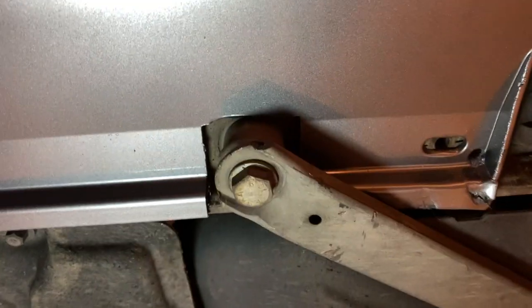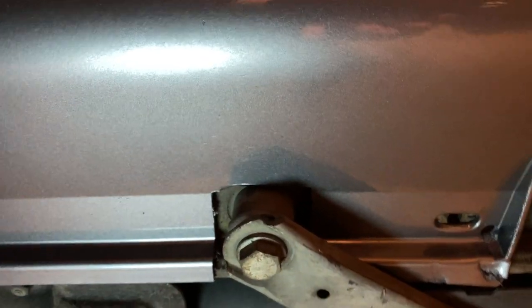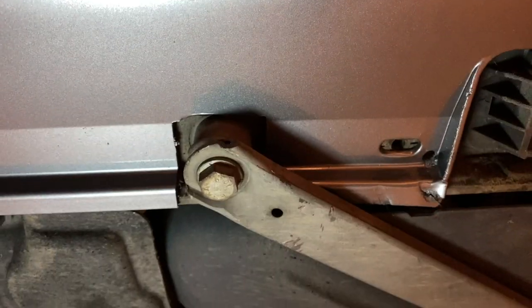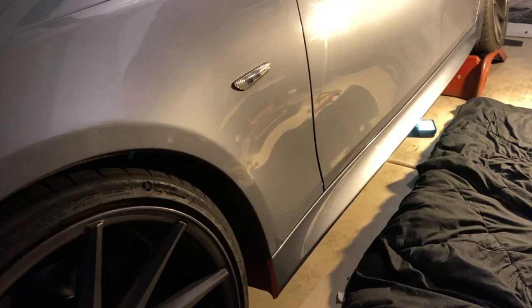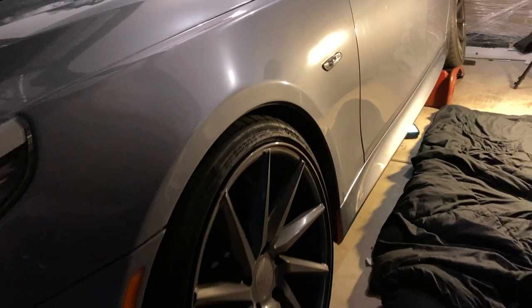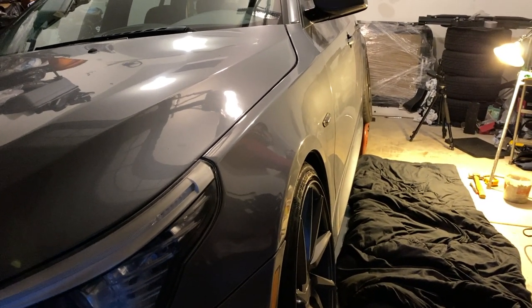This is how my cutout looks from underneath — I think it looks nice. Nobody's going to see it unless they go under the car. That's the only modification you have to do for station wagons to install real M5 side skirts, but other than that everything fits fine. I'll just make sure it's all pushed in, then reinstall the three 8mm screws and the plastic push-in pins. It looks much much better — especially with my car lower and with a wider stance. I think it makes a big difference.